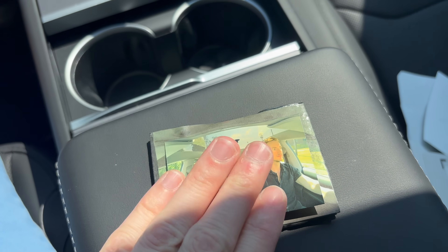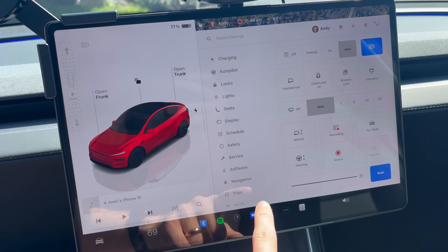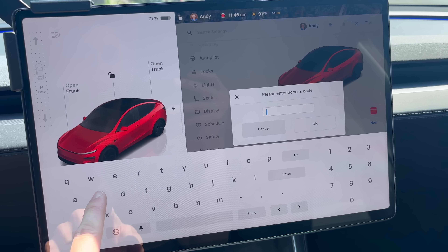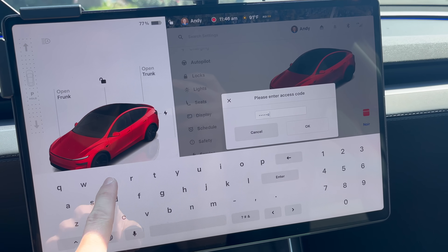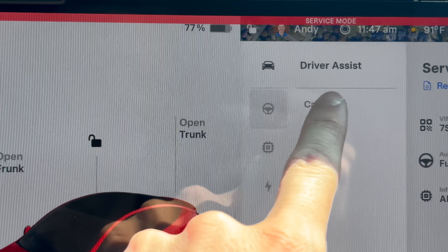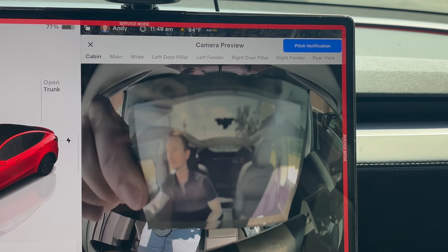It's just much better quality. Let's go into service mode and see if this actually looks good and fills up the frame correctly. In your Tesla, go to Software, hold down on the Model Y icon here. The service access code is 'service' all lowercase. This gives us a preview of the interior camera. If we go into the cameras and then camera preview, that's what the camera is basically going to see — and we'll see if that works.